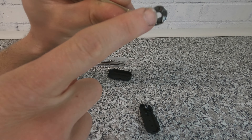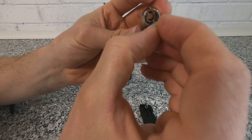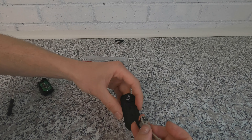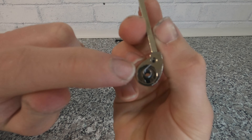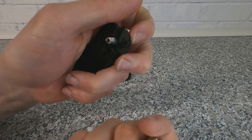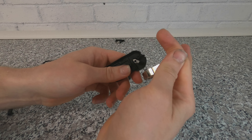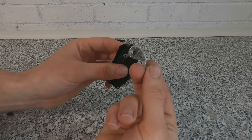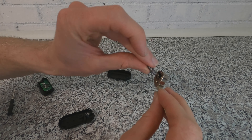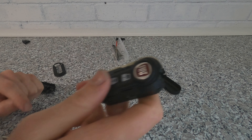Here's your spring — you want the spring that has the little arms on it. Put that inside this side, not the other side, because that is where the arm will click into those two holes. Now, to put the key together is going to be a bit awkward. You see this arm sticking up on the spring — you need to get that inside the little notch. You need to twist it in because if you leave it flat, when you press the button nothing happens. It's the spring being twisted that fires the key up.